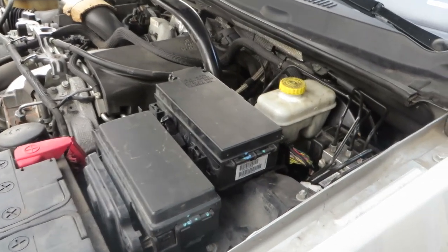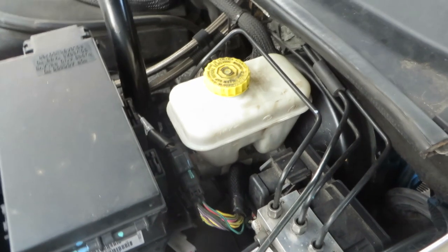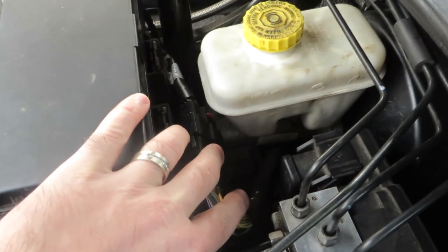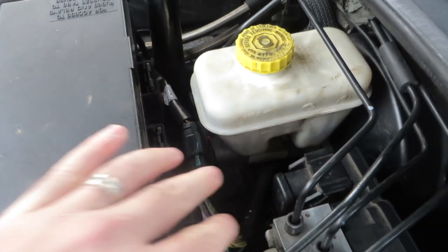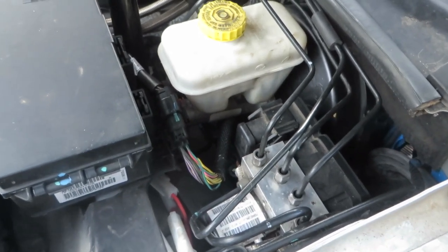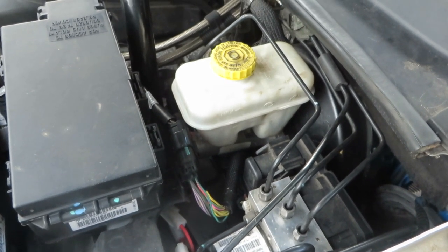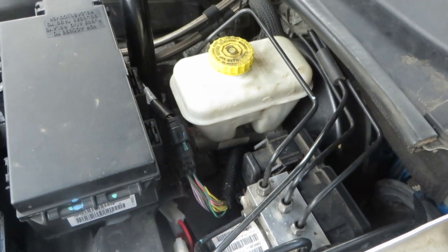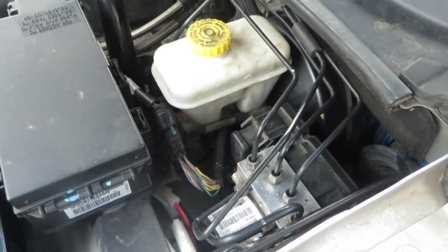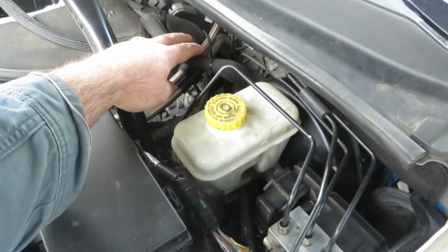It's been about a week since I worked on the Jeep. I ended up having to change the master cylinder after I put the vehicle back together - I now have the ESP master cylinder on, with the electrical connection left off for the sensor. After I put the vehicle back together and bled it, I couldn't move the vehicle - it was stuck. After I loosened the brake lines on the master cylinder, it instantly released. So I knew the master cylinder was the problem. I also tried bleeding the vacuum out of the brake booster but that didn't help either.